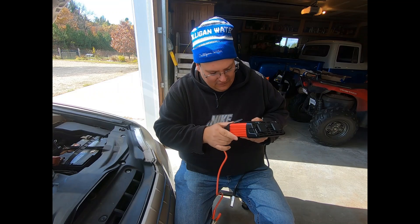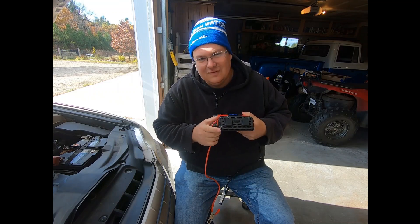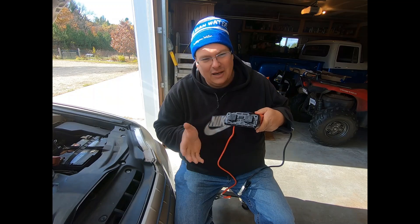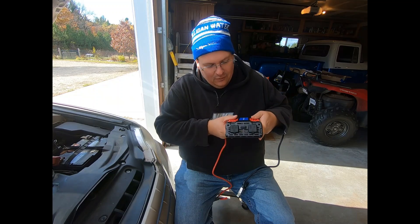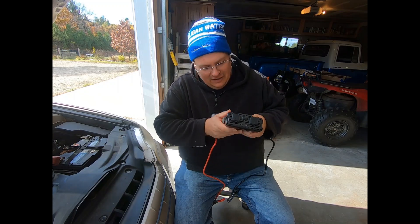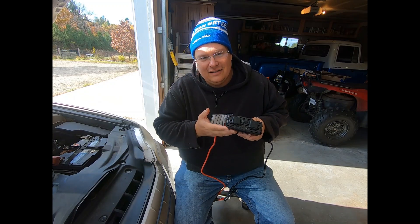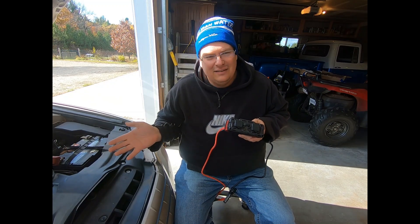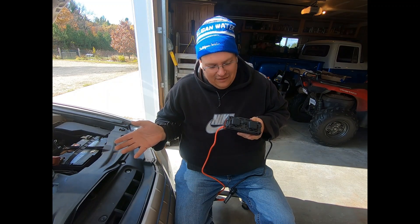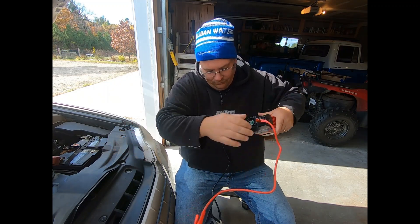A lot of inverters are metal, so I'd prefer to screw this down to a two-by-six or some piece of wood. That way, when I put it on the car it won't shift around — it'll sit nice and stable. Also, the wood acts as an insulator in case you accidentally contact one of your battery terminals. You don't want to short anything out.